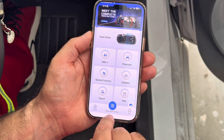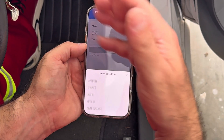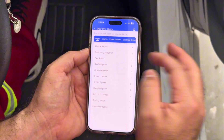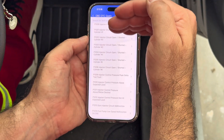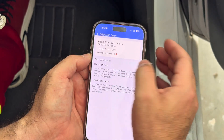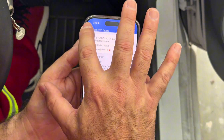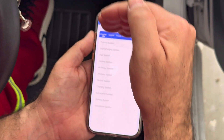We already saw the functions, which is great. I'm going to the application center — you can check technical bulletins just by selecting the vehicle brand. Look at all the brands — whatever bulletins this software has, you select the vehicle year and inquire for the bulletin. That's a trouble code query: control system, fuel system, cooling system. For the fuel system, it gives you every single diagnostic trouble code. For example, DTC P2635 — fuel pump low performance — tells you faulty fuel pump relay, faulty fuel pump, fuel pump harness open or shorted fuel circuit.